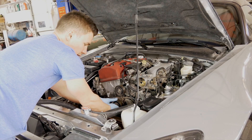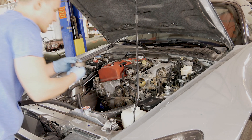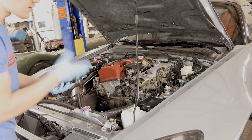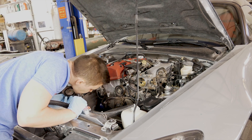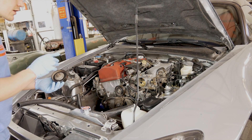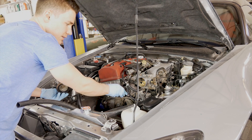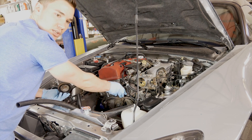I'm actually removing my idler pulley, and I'm also going to pull the tensioner pulley off as well. I'm going to be replacing my bearings while I already have everything off, because now is the perfect time before I add the supercharger — after that it's going to be hard to get to all of these things. The idler pulley is your typical bolt — just pull right off, lefty loosey. The tensioner pulley is reverse threaded.